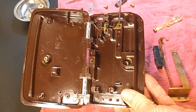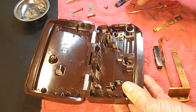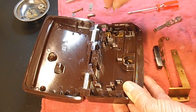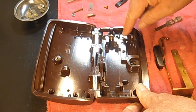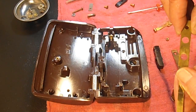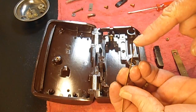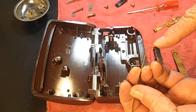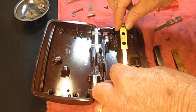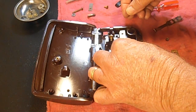So you remember down in here is one of the little brass nuts, and that goes for the contact screw where you screw the cord into, right? So you have that in there, and then on the bottom is going to go the shorting spring, and it's going to go with the tab end down. So it sits in there like so.